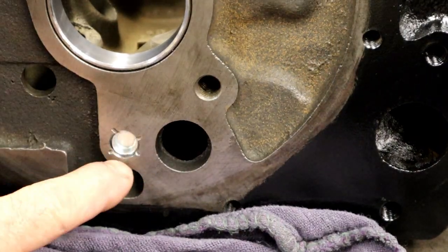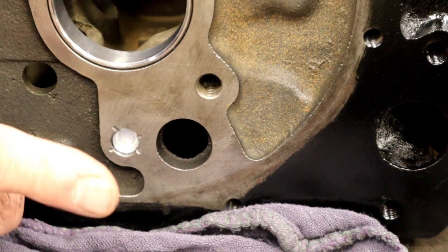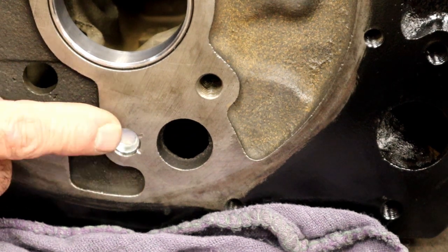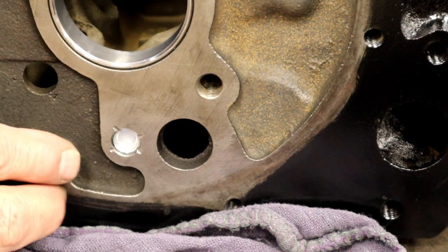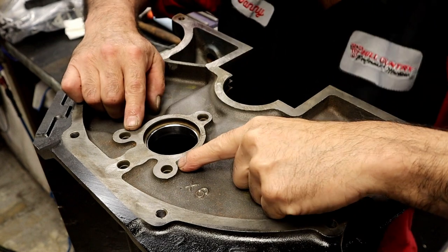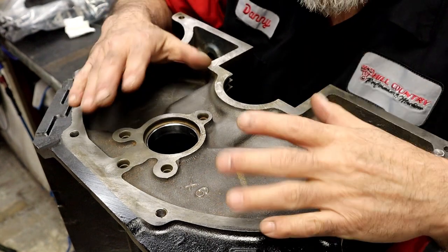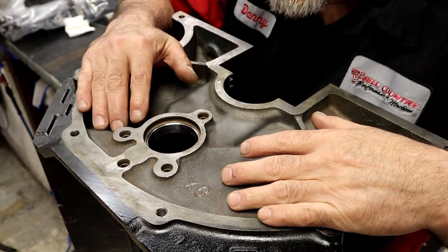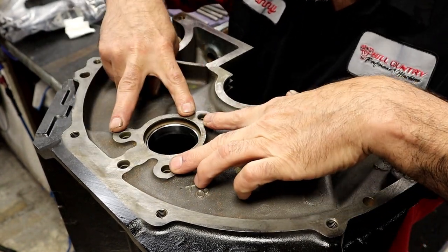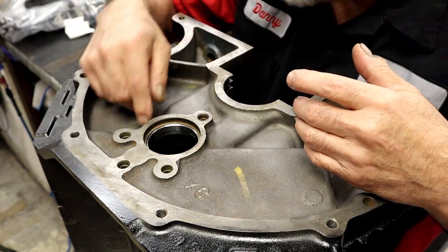Now you can see those little lines I'm talking about. I've already started this one and thought you may want to see this — it would be a good tip of the day. So I'm going to put the block up and we're going to put these in on the back. This block — I could do videos all day because there's tons of these on an FE. Here are the ones in the back of the block. There's one, two, three, four. Like I said, on a Ford FE, charge your customers by the plug and you'd make a lot more money. There's more plugs on this block than the space shuttle.